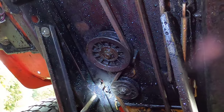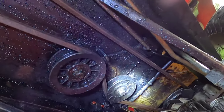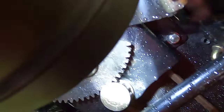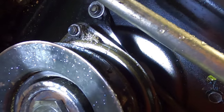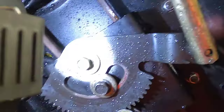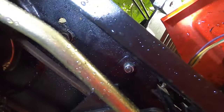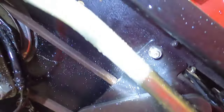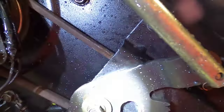The way I put the belt on: I started from the transmission in the back — no guide pins there. Looped around the two pulleys, put it through the bracket, put the belt onto the pulley, slid the pulley up, put that spacer in, put the shear pin in to hold it up, then connected the clutch. For some reason I went around the world taking extra things apart when there was no need. Looking at it now, I had to remove those bolts and take out the whole battery compartment on top because one bolt is under the battery tray. Once you have it all apart, don't forget to grease here — get the grease on while everything is accessible.